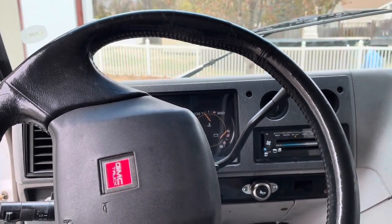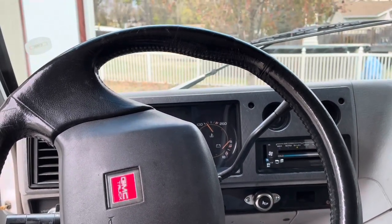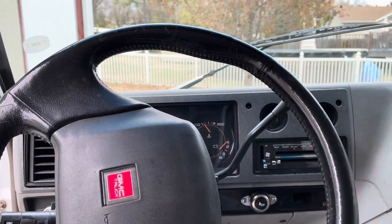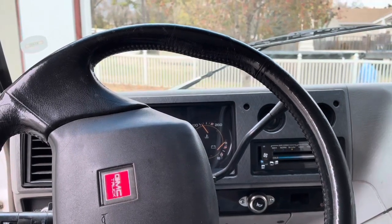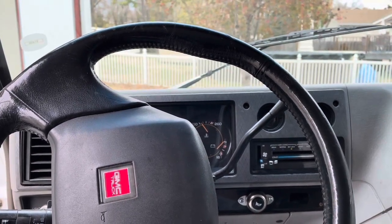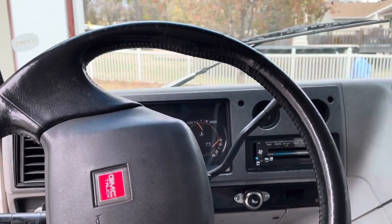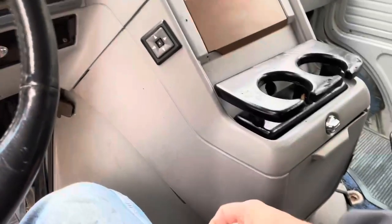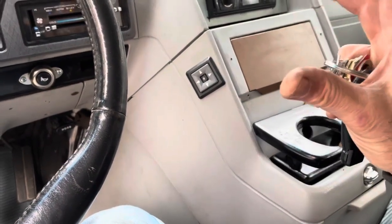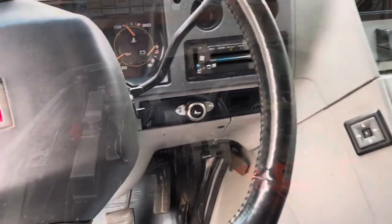I'll put the old push button doohickey on the starter. Let's just do the finger compression in the whole thing and see if we can get that thing on top dead center that way and see where that timing mark is. If it's close. And if that's not it, I think we're going to move to it. I can pull the doghouse off of here pretty quick and mark this distributor. Just pull this whole distributor out in one piece, set it in that engine, and see what it does. Okay, so let's check this timing mark first.